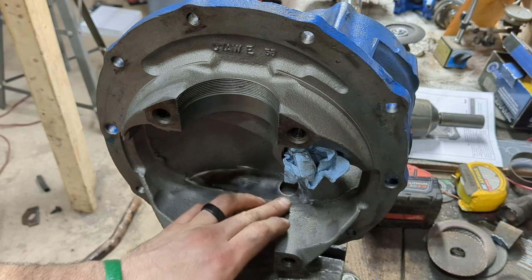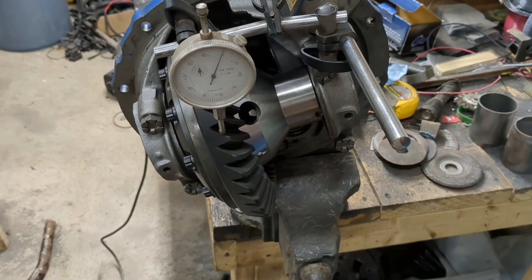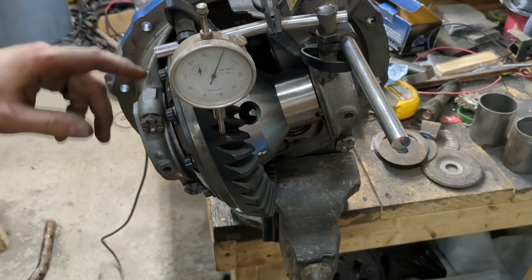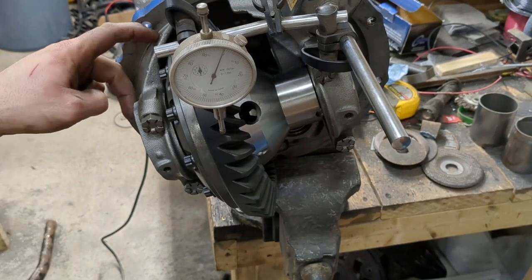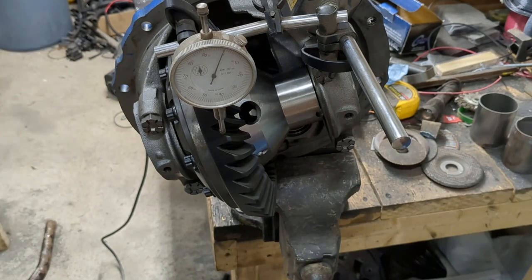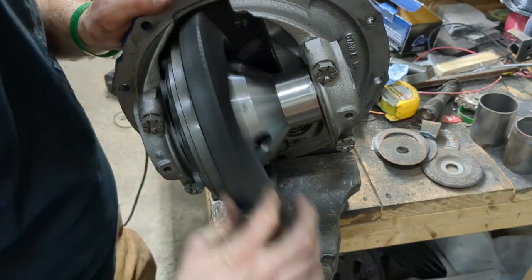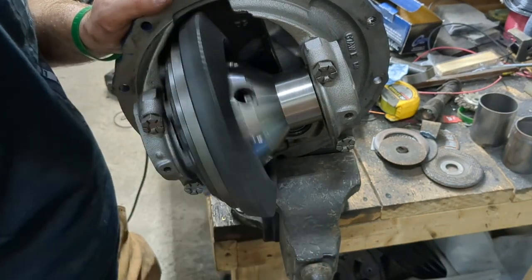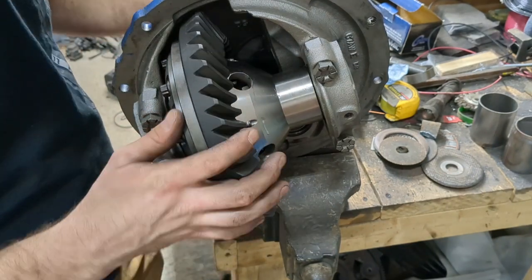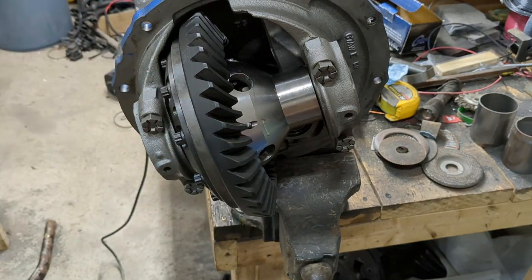You can barely even feel the ridge of what we took off, so let's see if that's enough. After grinding that case I reassembled everything. Now that we're trying to dial it in — this is not final because the pinion preload is not torqued yet — but I threw my dial indicator on and we're right about where we need to be: about 10 thousandths or so for backlash, and everything spins perfect now. We don't have anything contacting anything, and that's with about 10 thousandths backlash. The caps aren't torqued, nothing's torqued, but it at least gets us pretty close to where we need to be.